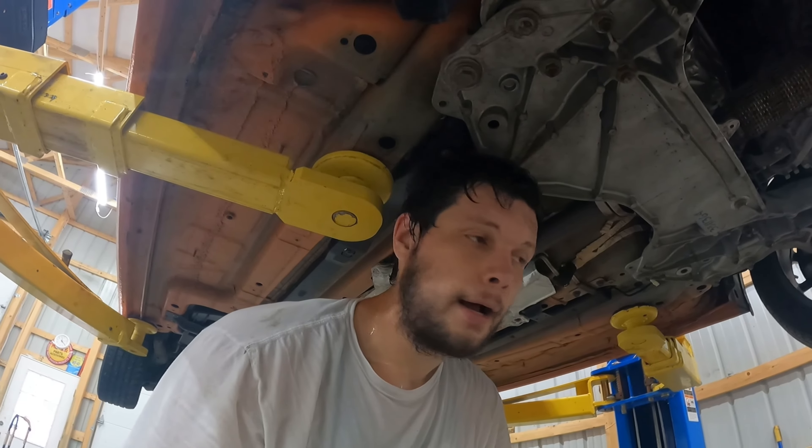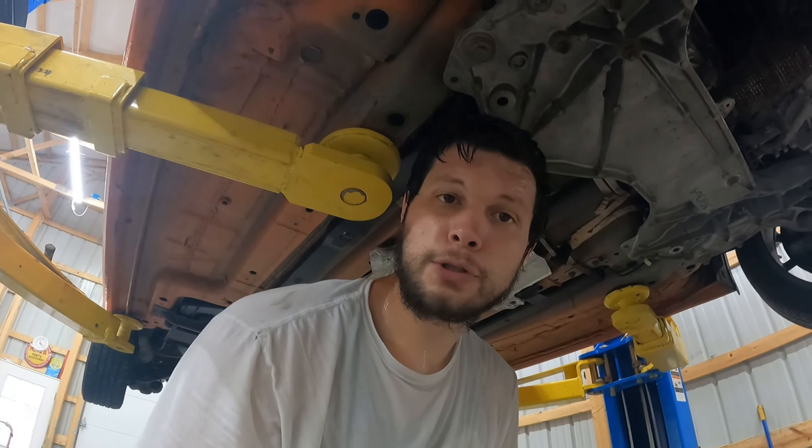Both bolts are tight on the front and back. Before I fully bolted it in, I slid the wire loom over the stud — it's such a short length wire I had to use the long pliers for that too. I need to put the nut on that now, throw some dielectric grease on the terminal, maybe scratch it up a bit with a flathead to make sure it's clean. Then I'll clip the signal wire in, put some dielectric grease there, put the belly pan back, and hook the battery up. If this did help you, like and subscribe — it helps a lot. I'm trying to break a thousand subscribers before end of year.